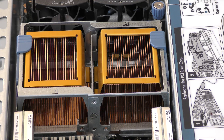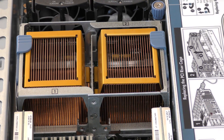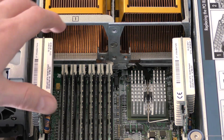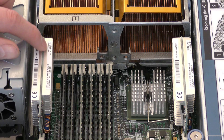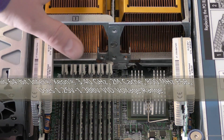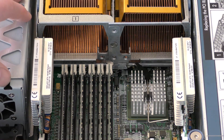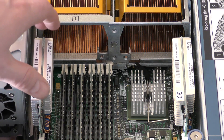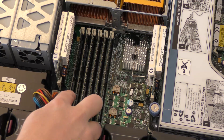These should be 64-bit CPUs. The server is available with several CPU speeds ranging from 3.0 GHz to 3.6 GHz. I know this server is equipped with two processors, each at 3.4 GHz — so this is actually the second highest configuration HP made of this model. These are the voltage regulators for the CPUs — they step down from 12V input to approximately 1.1V for the CPUs. When you add a second CPU, you get a second VRM alongside it.